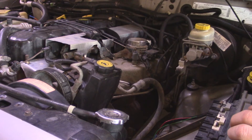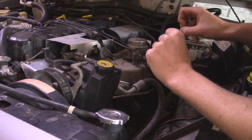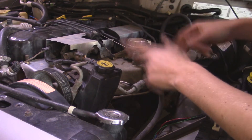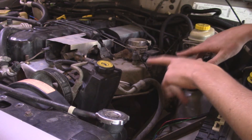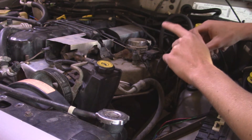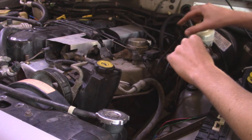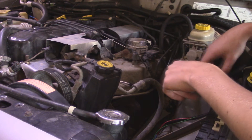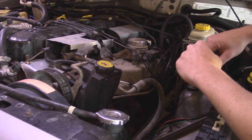So now I'm basically just going to disconnect everything that's connected to the intake manifold. I'm going to start off with the throttle cables and then work my way through the electrical and vacuum hoses. If you guys don't know where everything goes, I would take some time right now and put a little masking tape and write where stuff goes, or just take a lot of pictures if you forget. But since I've done this so many times, I don't need to do that, so I'm just going to go ahead and start unplugging things.